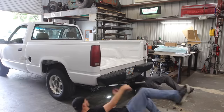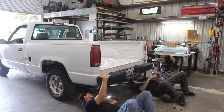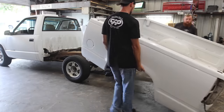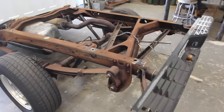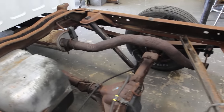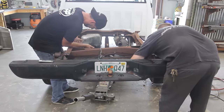To remove the bed, you just have to take out the six factory body mount bolts underneath the bed, as well as the screws around the gas filler neck. Then you can simply use a friend to lift the bed off and set it to the side. We're going to need to cut some underneath, and the factory frame is pretty rusty — we're going to remove all this old stuff, clean it up, sand it really good, and paint it black before we bolt it all back together.